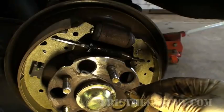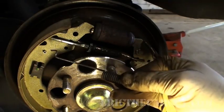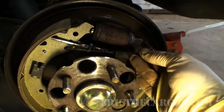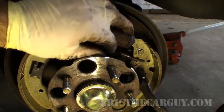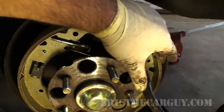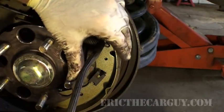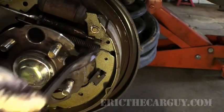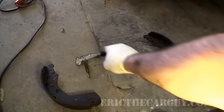Now for the big spring — if I remember right it hooked in this hole right here and needs to hook back over here. This is the dangerous part: I'm taking my long pliers, pushing with my thumb and pulling, also using the hub as leverage. It's almost in — I'm going to hit it the rest of the way — and away we go. Actually quite simple. Lastly, let's get our parking brake lever assembly and install it.